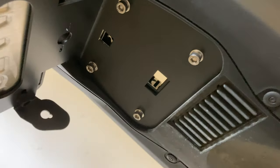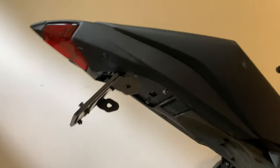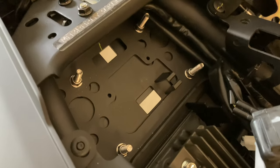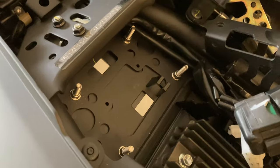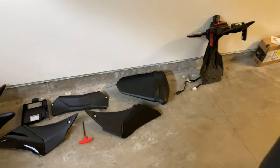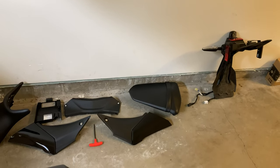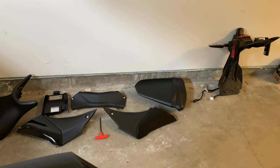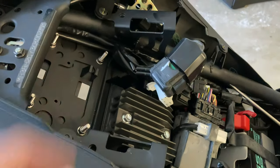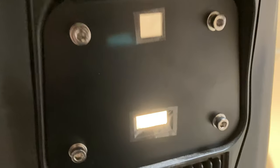Now that looks clean — no goofy lights, none of that stuff. You can see on the inside the bolts sticking out; it's a nice tight fit. If you're feeling ambitious, you can add your turn signals back — you have to disassemble that big whale tail thing, take the wires out, feed it in, and mount it. Make sure to plug everything that you moved back into where it came from. Put a small bit of packing tape over the holes to keep dust out.